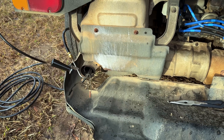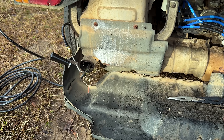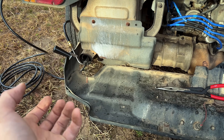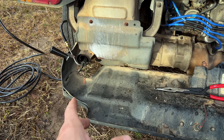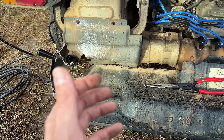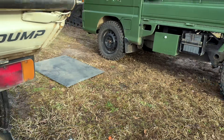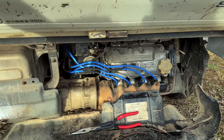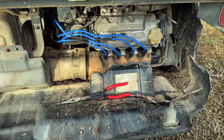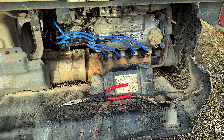We are all good and this little booger is purring like a kitten, running very clean. No smoke out of the tailpipe - likely doesn't need valve stem seals, because if it did it'd probably be leaking all the time. Although if it was cold, they could leak and then temperature makes them swell slightly to seal again, so we'll see if it smokes on the next cold start. They wanted the valve stem seals done at 200,000 kilometers - probably going to do that when we do the rocker cover gasket. Thank you guys so much for watching - don't forget to like, comment, and subscribe for future Subaru and tool content.